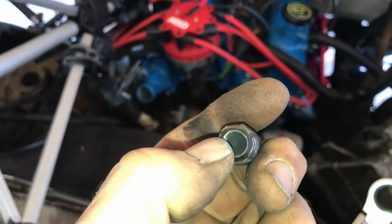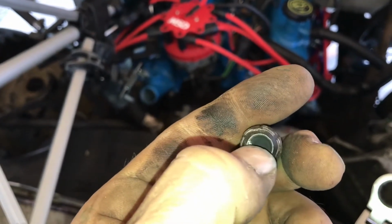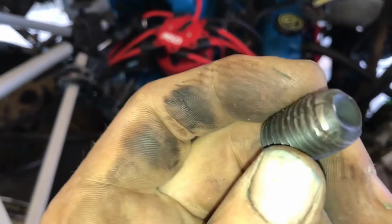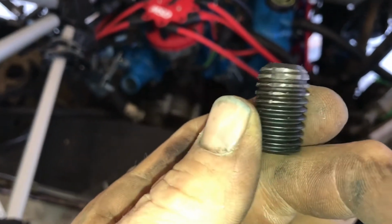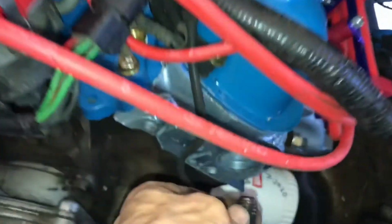And just take a Dremel tool, and when you grind these, you don't want to grind straight towards the center line. You want to grind kind of across like that, where that's got a slight bite to it, a tooth, kind of like a skill saw blade. And that's what you do to make a poor man's tap or a thread chaser. So you just put that in here,